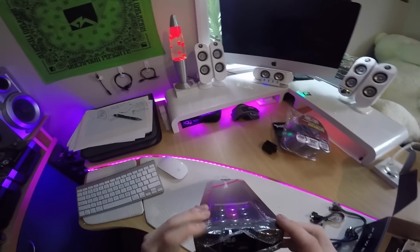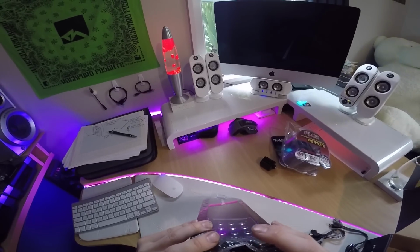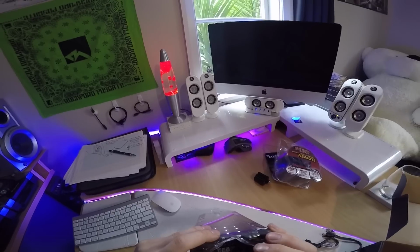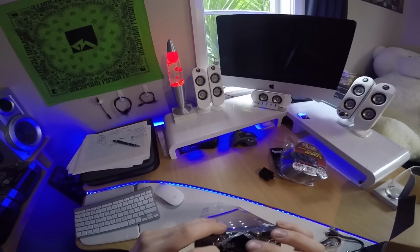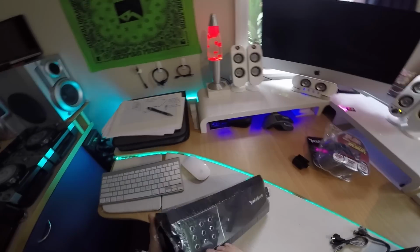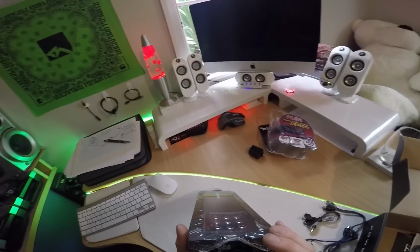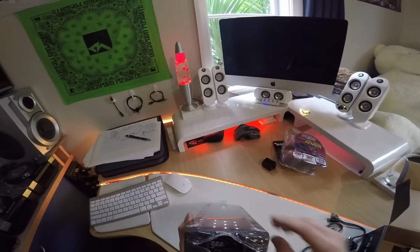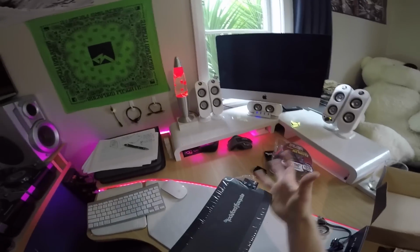Also, beside that, we've got a 2-channel and 4-channel switch, so that if you are running, like for your speaker output side, you can run it off just 2-channel input or 4-channel. So I guess potentially you could run all 5 channels off just a 2-channel input. You'd set this to 2-channel, and then you'd set the subwoofer channel to off. So that way you could have 2 channels going in and 5 coming out, so that's quite cool.